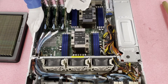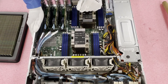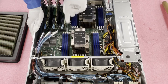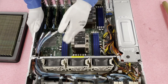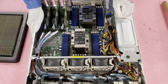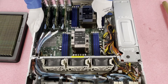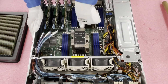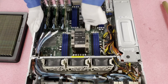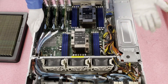When you come back over here for the second set, it's very similar — you're going to have D1, E1, F1, where E1 and F1 are their own individual channels, and D2 over here pairs with D1 for that channel. The exact same layout applies for CPU 2: A1, B1, C1, A2 on one side, and D1, E1, F1, D2 on the other. In case you're concerned, right in between the heat sinks it is all labeled on the motherboard itself — Supermicro has done us a favor with a nice easy-to-read code, and it's also color coded, which is very helpful.